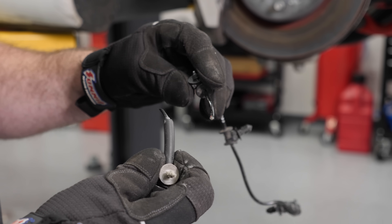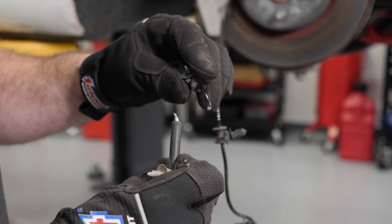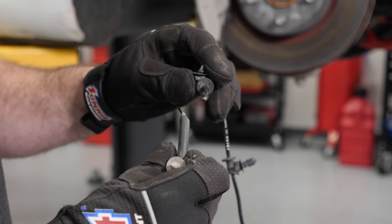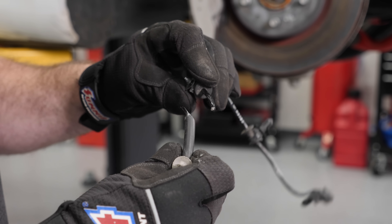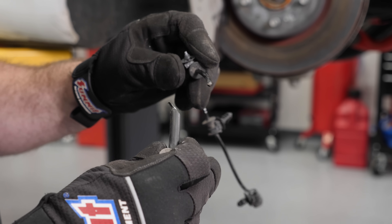Here was the source of our failure on our Tesla — a broken ABS wire. When you lose that, you lose a lot of stuff. This can be a dangerous aspect, especially in the middle of a race course. So always remember when you're installing new parts and products to always check your clearances before going out on a final test drive.